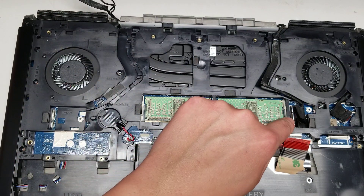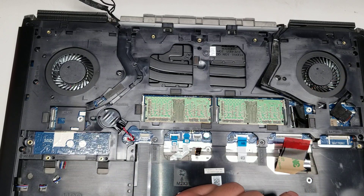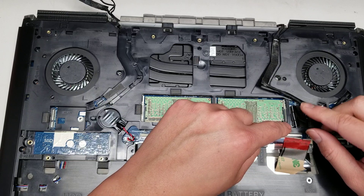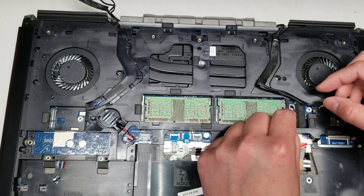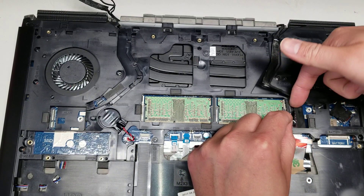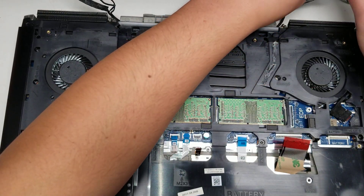This connector will actually be under this metal piece. Basically just take this one screw out and then you can remove that. This part will be folded down — flip this plastic piece up and then just pull on it. It's going to be difficult, so what I do is help with my finger to pull this edge up and then pull it out.